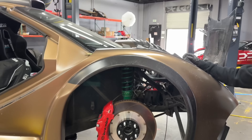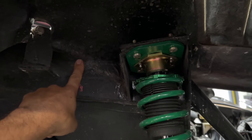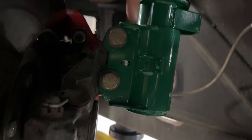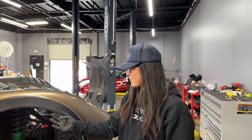Because of the slanted front end trying to look like a supercar, the shock sits lower which makes the car higher. They don't have much room to work with, and the fender is glued on just like a Murcielago — it is bonded. So on the front, instead of modifying the chassis, we might take these, cut them off the shocks, move the stuff around, and make new ones if needed. There's space on the shock, so we'll keep the shock travel but move the mount up — basically like a drop knuckle. That's our project for the next probably two days: get this thing to a normal ride height, then we can do some actual cool stuff to this car.